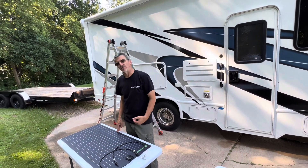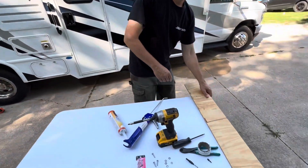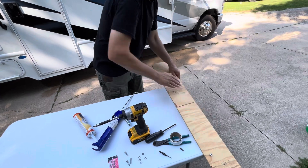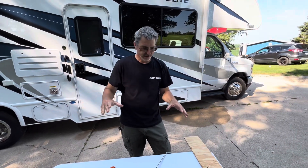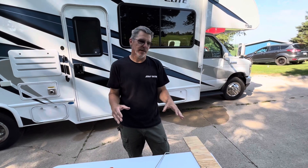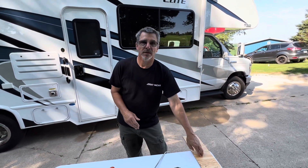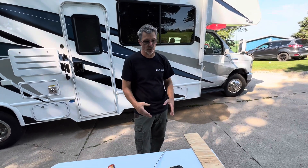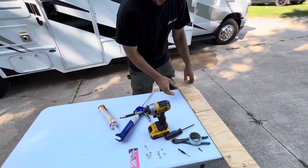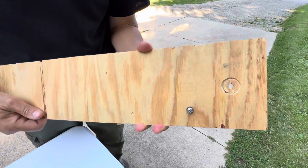There are a couple of ways you can do it. If you had a fiberglass roof, that'd be easy — I would tape it or glue it. But this has a rubber roof, which means there's some three-eighths plywood with a rubber membrane over it. If I glue or tape down to that rubber membrane and the membrane isn't secured everywhere to the plywood, I'm concerned it would just rip the membrane — then we've got a real big problem. So we're going to use number 10 stainless steel screws with little washers.